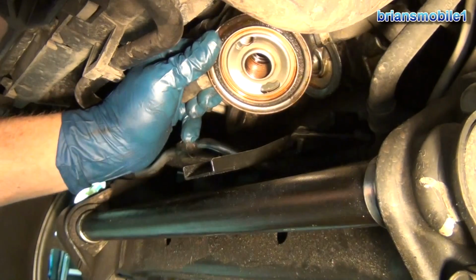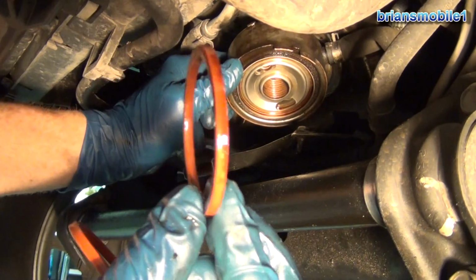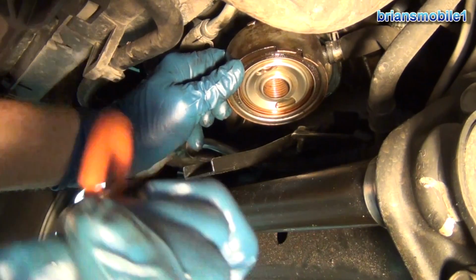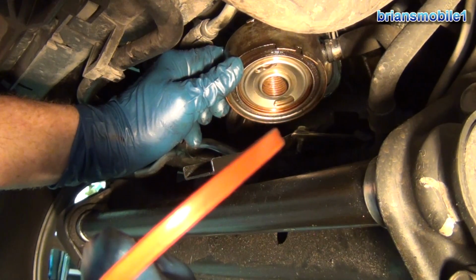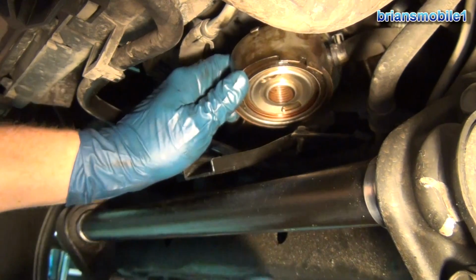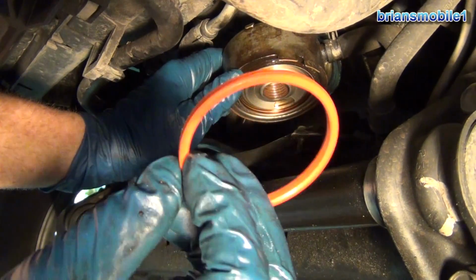And then you take your new O-ring. And sometimes they won't be completely flat like this one was. This one was just completely, totally mushed, cooked, and done. Sometimes you'll have just a little lip on it. You can see that it sticks out just a little bit at the end on the uphill or left-hand side. So sometimes they'll be like that and they'll leak just a little bit. When you get them new, they should look about like this. Here's a new one from the dealership.